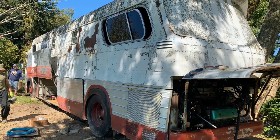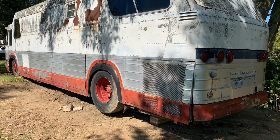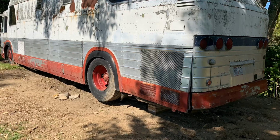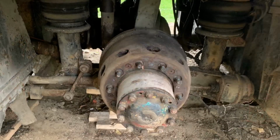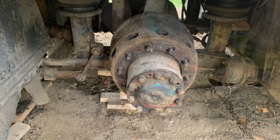We lifted the bus. We got it rolled forward a little bit. Brakes are all free, but it does have 30-plus-year-old tires on it, and I didn't feel like paying the wrecker operator a couple hundred dollars an hour to sit on the side of the road and change a blown tire. So we pulled the old rubber off both sides, and pulled the drive shaft.